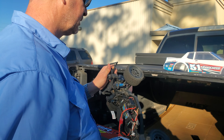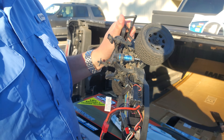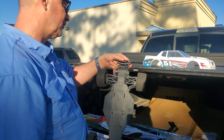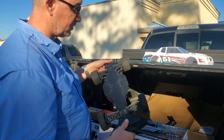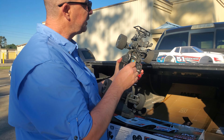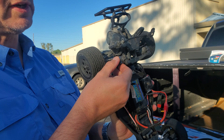It comes with the brushless motor — here's the brushless system in it. I can't remember how many KV it is — 3300 KV, my cameraman tells me — 3300 KV. It's got the aluminum-body shocks, but it does come with spacers. It doesn't have threaded shock bodies, so that is something that you might want to consider upgrading in the future, front and rear.